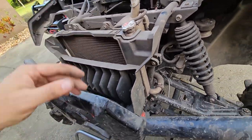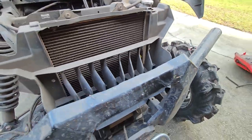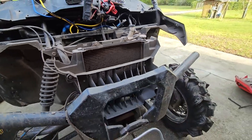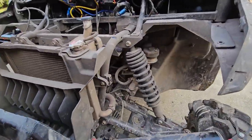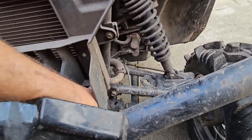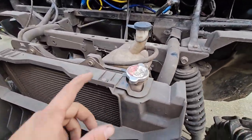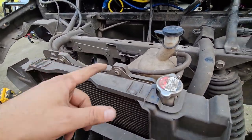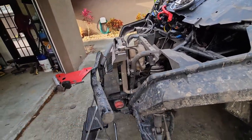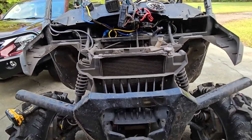Here's the radiator — it's out in the open now, very easy to get to. You can see that the shield is shaped so you can get to most of the stuff to clean from the front, but from the back it's kind of covered up with the fan and stuff. Pulling the bumper would help here. I'm trying to see if I can do it without, but I've got to get to some 10 millimeter bolts that are down in here. So I'm going to go ahead and pull the bumper because it's really quick, then pull this shroud off with those two 10s and these two clips, then pull a couple more 10s to get the radiator separated from the fan shroud — leaving the fan shroud in the frame. Then we'll drain the coolant and flush the radiator really good.